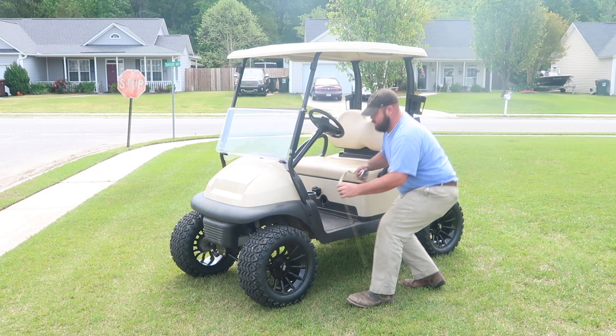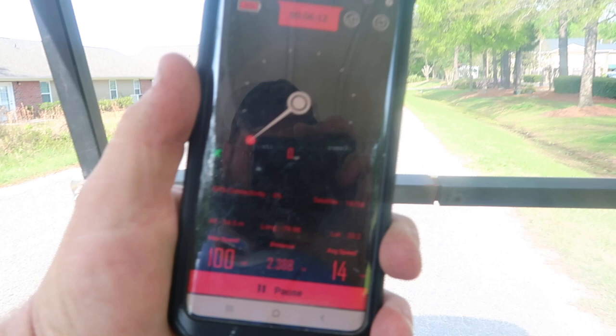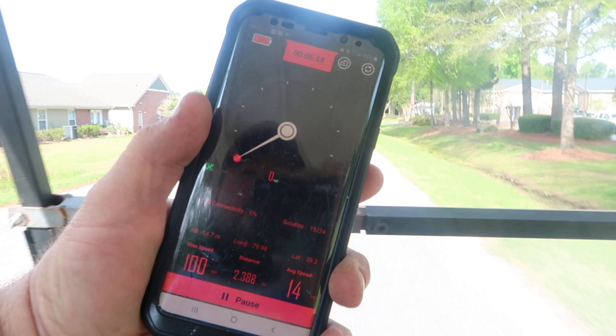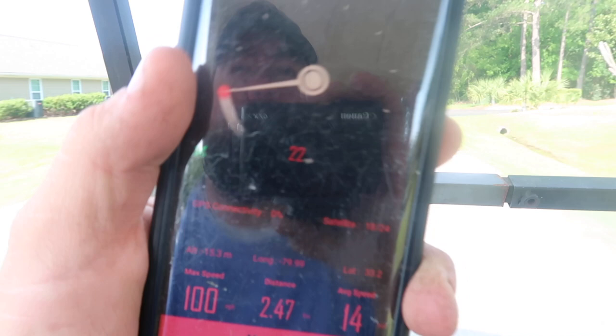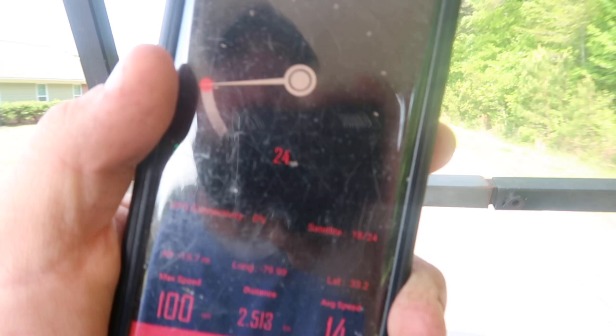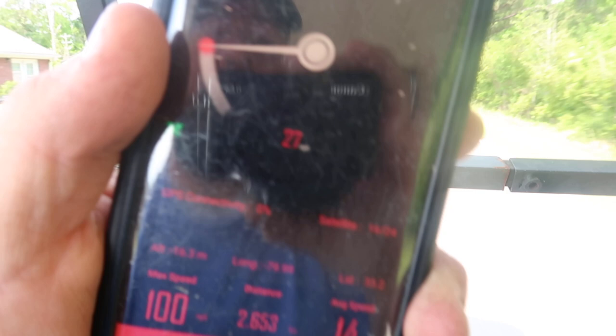This last portion of the video is going to be shaky — I was by myself. When you lift golf carts and put on oversized wheels and tires, the oversized tires will give your golf cart a better top-end speed. In this test, we see how fast the golf cart is. If you remember, the golf cart went stock at 12 miles per hour. We put the Plum Quick Bandit motor on it and it went 23 miles per hour. And here you can see this golf cart was able to reach and maintain a speed of 27 miles per hour. We gained four miles per hour just by doing the lift kit and the wheels and tires on this golf cart.